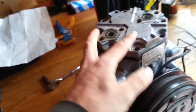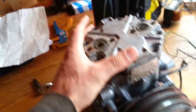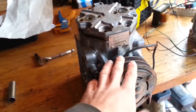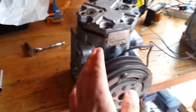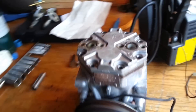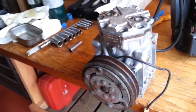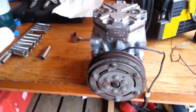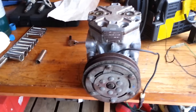There are a lot more of these with flange fittings. It seems about every 83 Volvo I stumble across has one of these things. If this works out really well, I'm probably going to end up getting more. People use these for air compressors — 10 cubic inch, and I think somebody said at 3,000 RPM it'll put out like 9 cubic feet per minute, so at 6,000 RPM you're close to 20 cubic feet per minute. They're pretty beefy — 18 CFM is plenty to run some power tools or onboard air for off-roading. But I'm not interested in air, I'm interested in refrigerant.